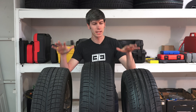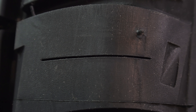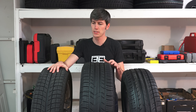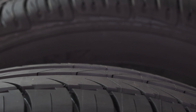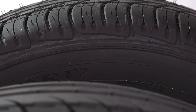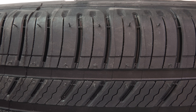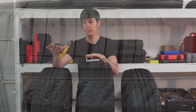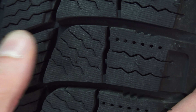When it comes to compound, the biggest difference is about what temperatures these tires perform best at. The summer tire has a compound meant for temperatures generally above about 40 degrees Fahrenheit, versus the winter tire whose rubber compound can dip well below freezing and still remain soft and flexible. Take a summer tire down to those cold temperatures and it starts to get really hard and loses grip. The all season tire is the compromise — it can remain somewhat flexible around freezing temperatures, but also operate in higher temperatures where a winter tire would be far too soft and wear way too quickly.